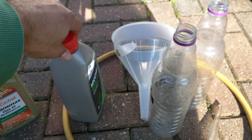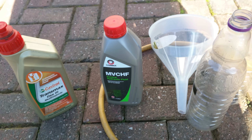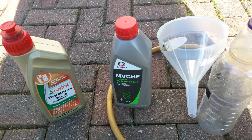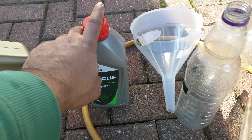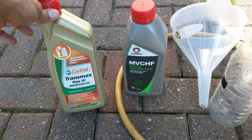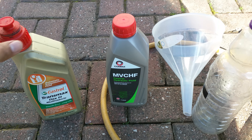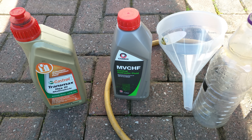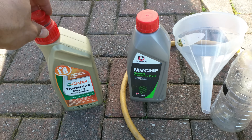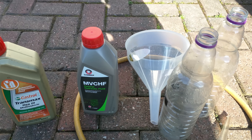You don't need much, not very technical at all. All I'm going to be using is a litre of power steering fluid. You may need more if your fluid is in really bad condition and old and burnt. The one I'm using for my car is CHF, which is central hydraulic fluid. Your car may require ATF, automatic transmission fluid, which also doubles up as power steering fluid. Do check your owner's manual though, because they're not interchangeable, so make sure you put the right one in. If you think you've got the wrong one in, just run through two or three litres of the correct one and get it back to the colour it should be.